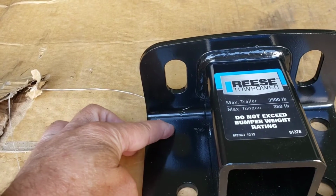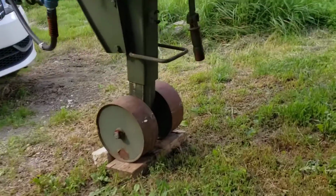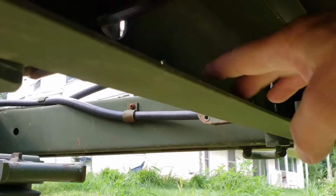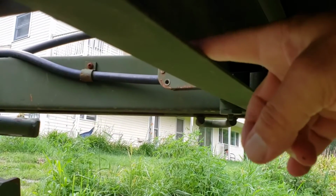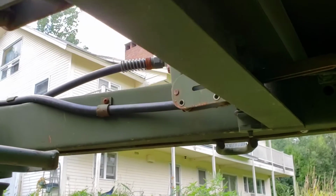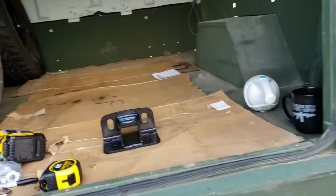And then these two front ones right here are also going to have a little bit extra support, because I'm going to mount it to a lip that extends to the center of the trailer. So if you look right here, you see this lip. This right here is even with the back of the trailer, and then I just drilled through. This is about 1 3/8 thick. I got 4-inch bolts. I'm just going to drill right through here and mount those two bolts through those holes, in addition to being through the floor. So I'll have a little bit of extra support there, where the 1101 did not have that.